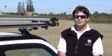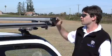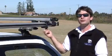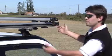The first thing you need to do is set up and position your ramps. The ramps are located in the ramp holder brackets on the underside of the boatloader crossbar. To remove these ramps, simply loosen the nylon knob and lift the flap up, then pull out the ramp.